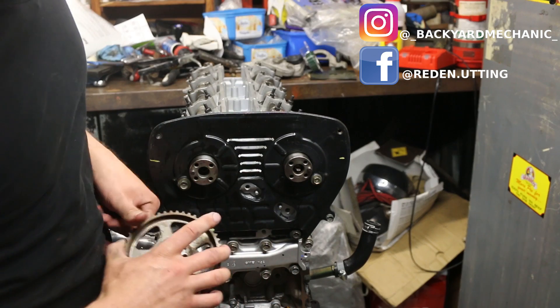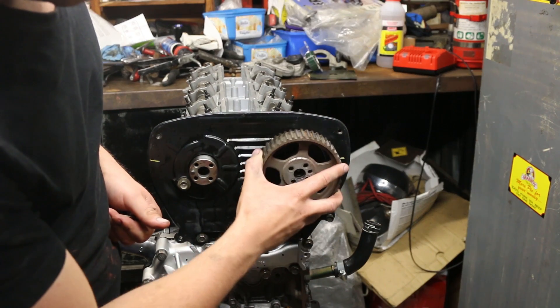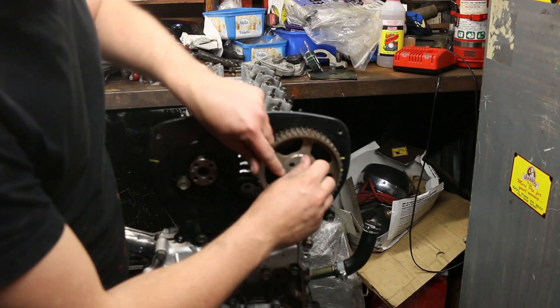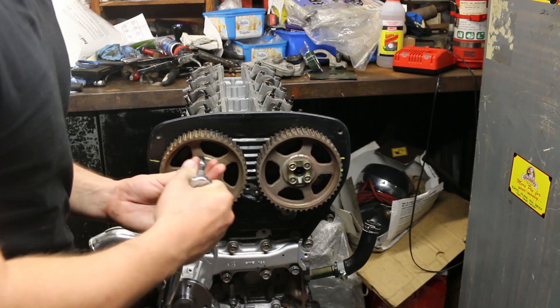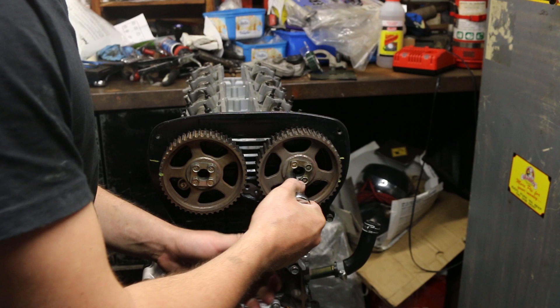Now we're going to put our cam gears on. We've got our cover with our timing marks here, so let's go ahead and put our gears on. Now hold it there — this can be disaster if you're not paying attention. Notice the camshaft turned while I was tightening those gear bolts. Make sure you just nip them, because if you try and tighten them too much you risk sending a valve into the top of the piston. We can't afford to damage any of these new parts, especially our new shiny forged pistons. Once the timing belt is on, that's when you can tighten these bolts up properly.